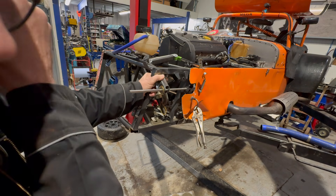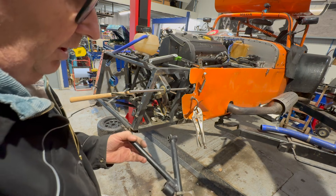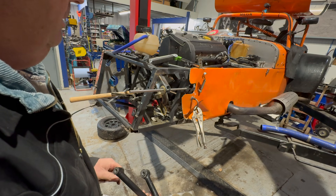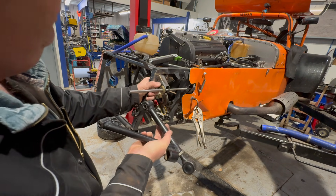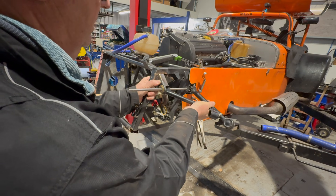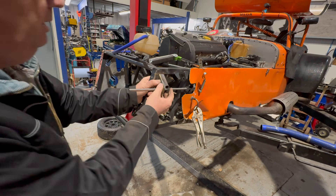I notice on the wishbones — possibly because they've been running out of line before — the rubber bushes don't appear to be entirely straight. I know that it has to go in like that and I can measure it once it's in. We'll pop that in and see if we can get it about right. I've measured it, it now fits, and there's a straight line all the way through. I might just weld it in like that because that's going to fit in there — front to back that's okay. So I'll get this clamped up and we'll have to go brazing it in.